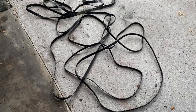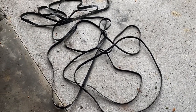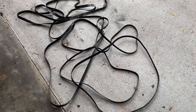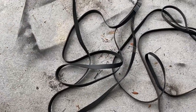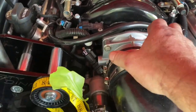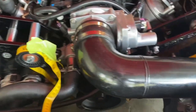You can see I have some experience with belts here — I got a problem with belts. And these are just the ones I didn't throw away. I got a spare one in the hatch. These are through the few years that I've done the LS swap; I've had a few different configurations. I first had an R4 compressor, then I changed to a Sanden, and then recently I put these LSA brackets on it. So those two belts are 8-rib — very long — and that's going to be when I put the blower on. That's going to be the Dirty Dingo bracket setup.